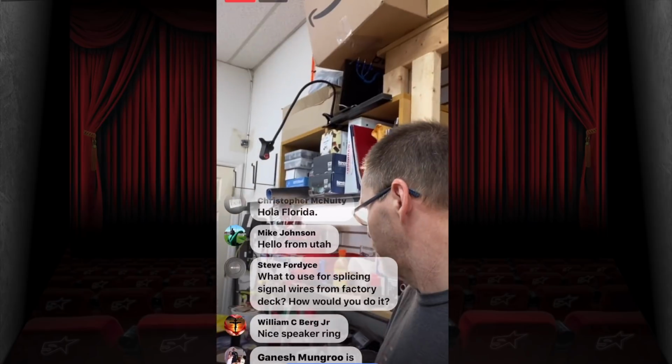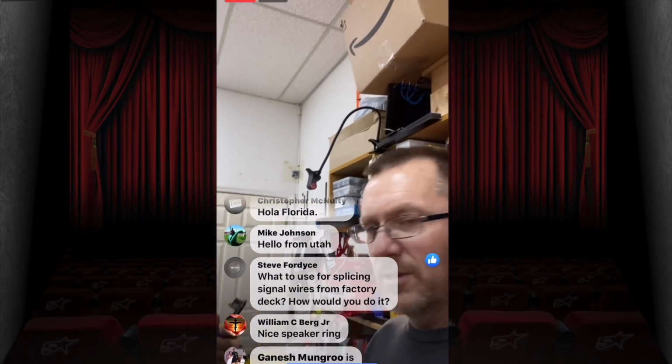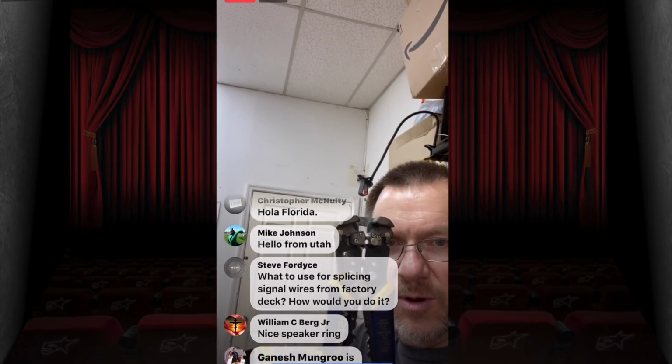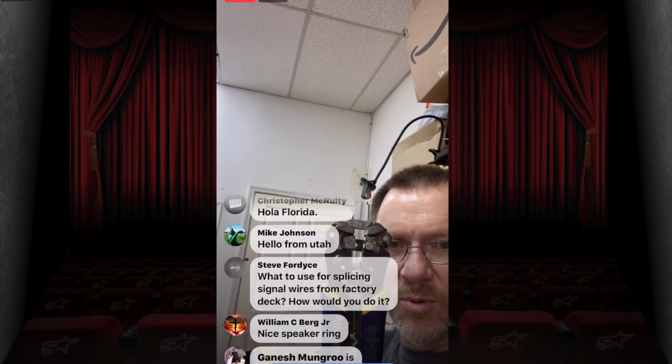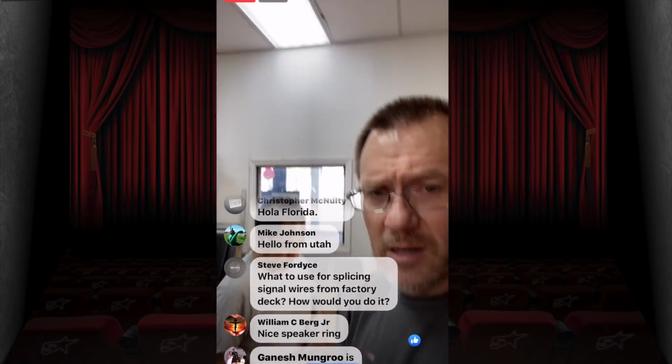Do you have wire strippers? You got your wire strippers? I got my strippers in here. Let me see your strippers. We typically take these strippers right there. We put the wire in. This closes, and that will pull the wire apart. And then we do a poke wrap and solder, depending on the size of the wire.